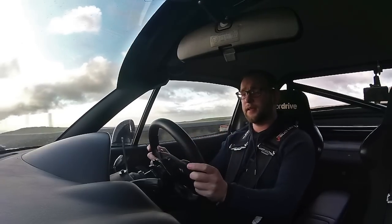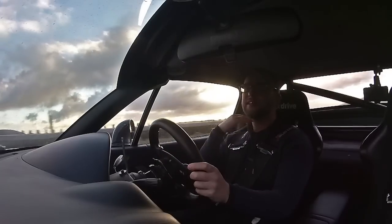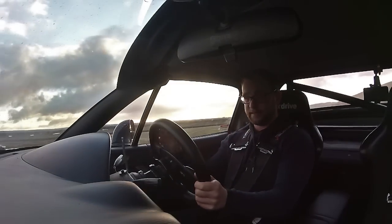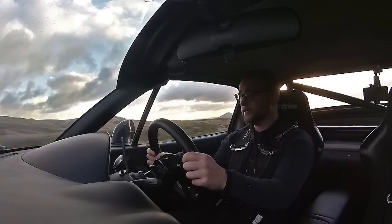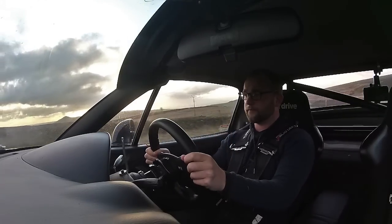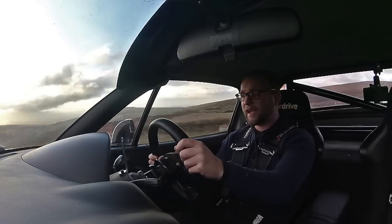When I put my setup in, the turbo was actually touching the chassis leg, so we ground the lip off and I had to spend over £100 on some stiffer engine mounts. These things just incrementally add up to costing you a lot more than you factored for originally. A free-flowing exhaust system makes a real difference - I'm actually running more power with the new exhaust system at 4 psi less than with the standard system. Another begrudging item was the Skunk2 throttle body, especially as a common issue on them is that they jam open, so I had to rebuild it and move the hole for the spring to add more tension. Under boost applications, OEM throttle bodies have been known to shear the throttle body bar - fairly rare, but I didn't want to take the risk.